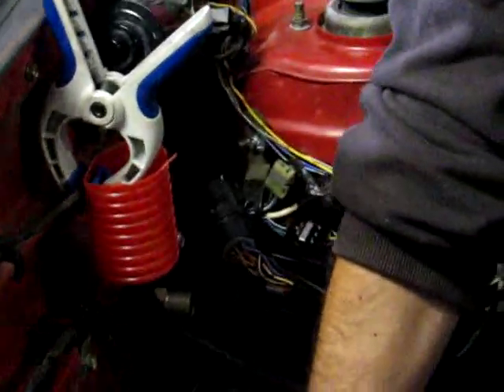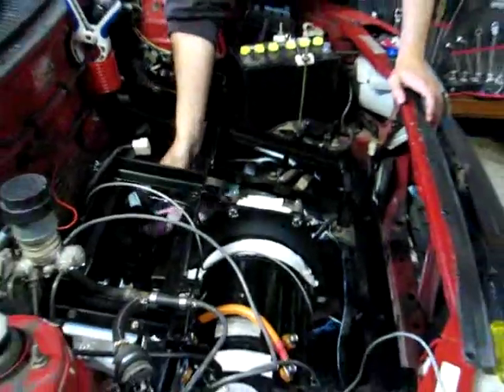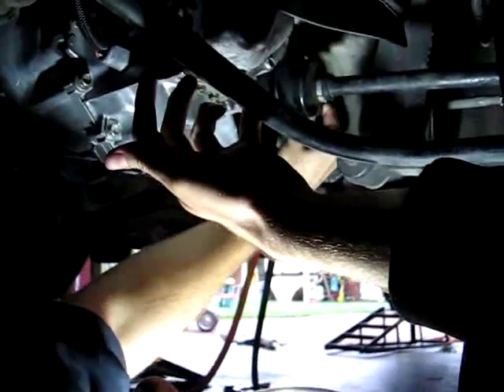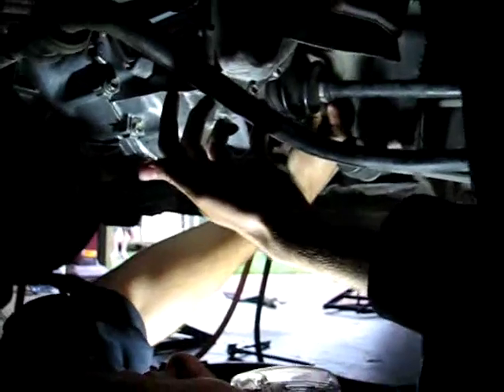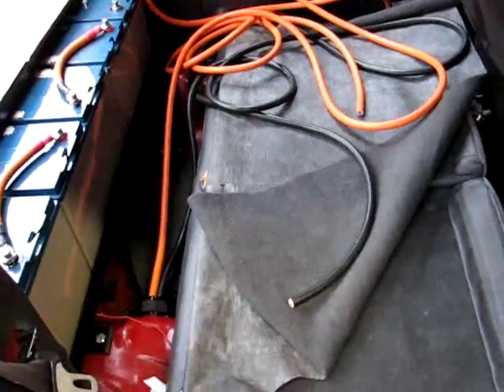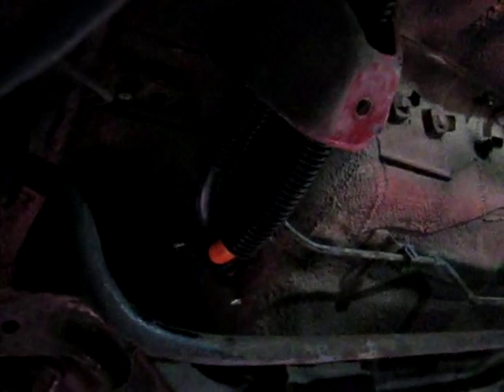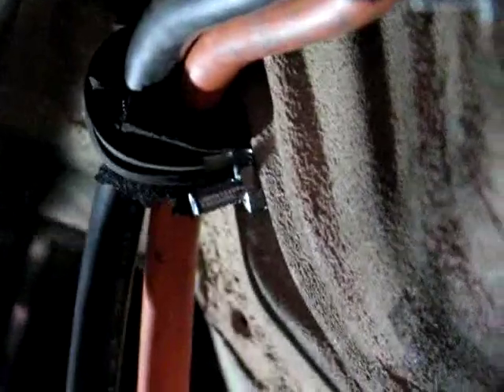Transmission oil going in through a funnel system made from a modified fuel siphon. Poor Geoff's underneath the car while Ryan is cleaning up, wiping drops off — some of which are falling onto Geoff. Just put it in the hole — there's a lip inside. It's leaking quite a lot. Pull the cables through the gland. This is the gland — there's a hole just behind the seat through the body. That's our aluminium plate, coming out underneath, routed by a conduit. This is the high-voltage cables attached by clamps — has to be a minimum of every 600mm.